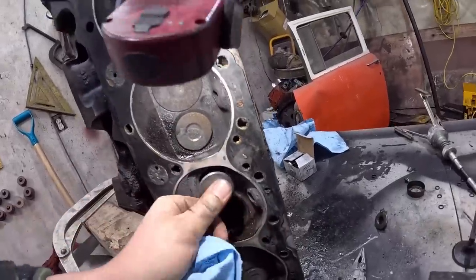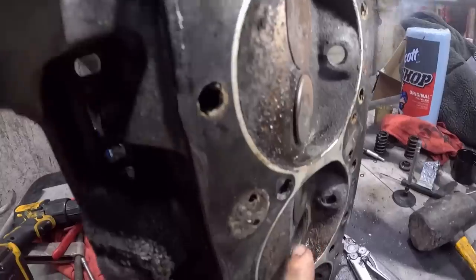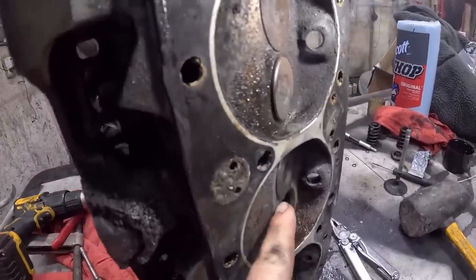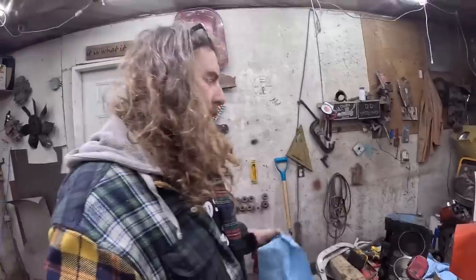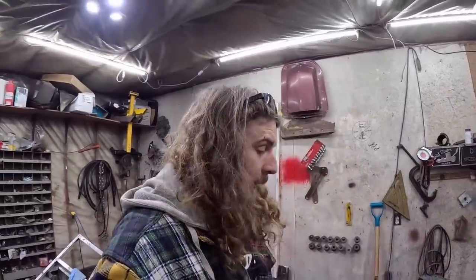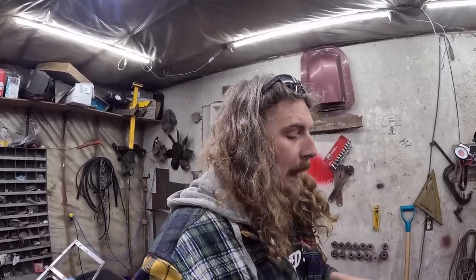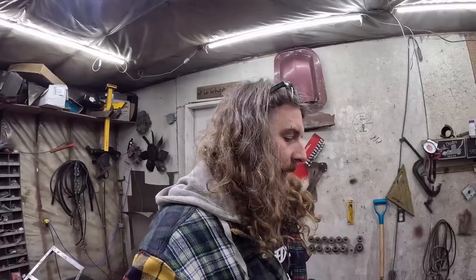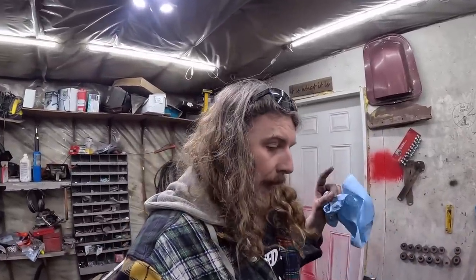Now if you look at it, the valve goes in. It sits in further than the one right above it. But, hey, so she goes, it's like just having one pounded valve. Now, let's be honest, you guys out there running your jalopies, one cylinder's not running as good as the rest anyways. We just know which one it's going to be in this. Now what we're going to do, I'm going to show you the correct way of lapping a valve on the intake side, because it really didn't need much. It could probably just be slammed back together, but we're this far apart.